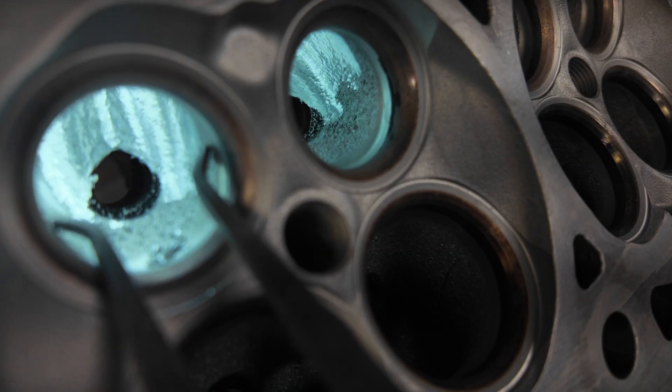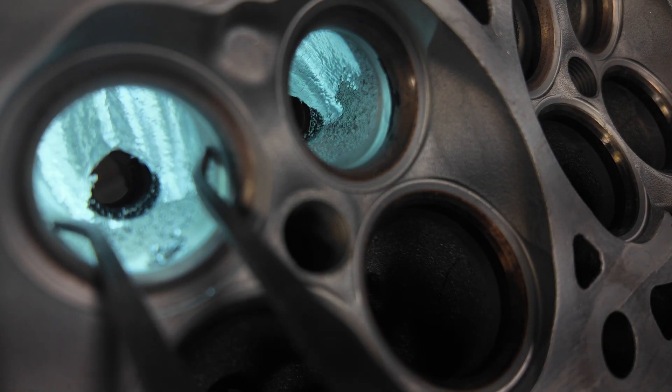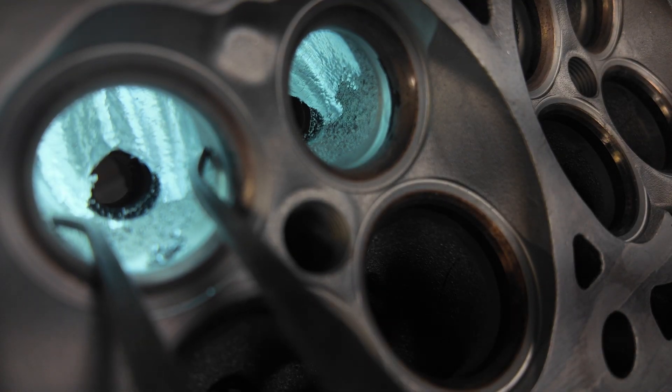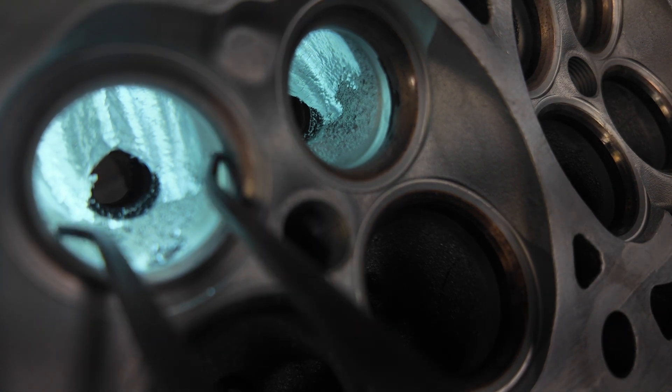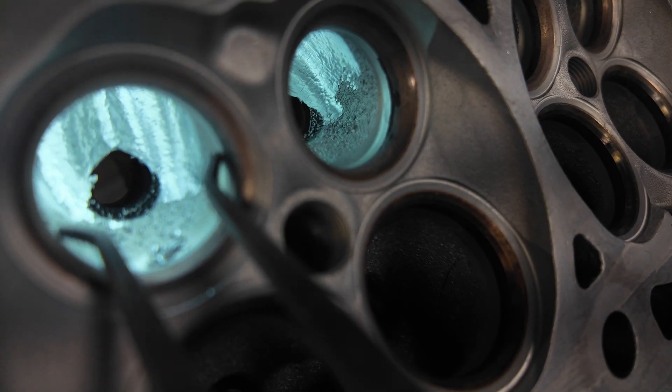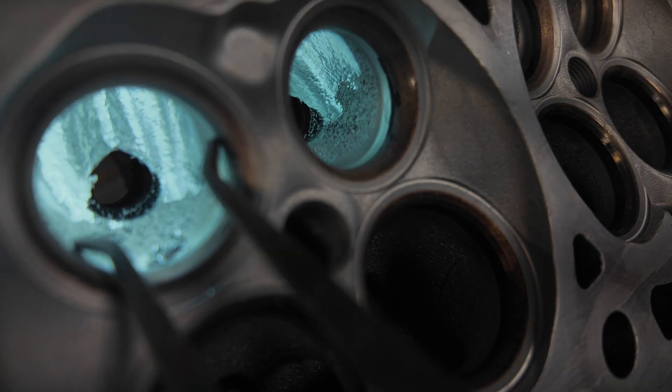You need to make sure that this is within a percentage of the size of the valve — you can't just go big and port willy-nilly. You really want to pay attention to the size of it. So you take an inside caliper and you can measure it, see where you're starting, have an idea of where you want to go with it, and just plant it there.